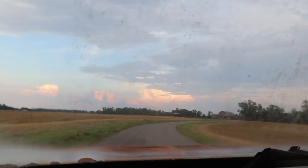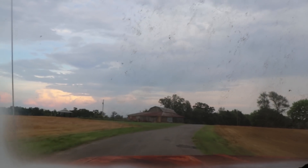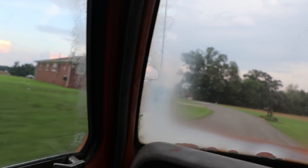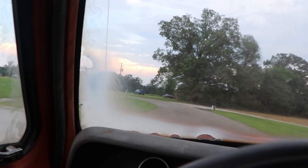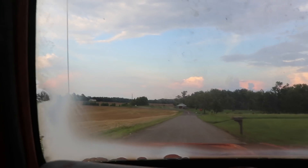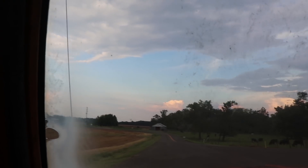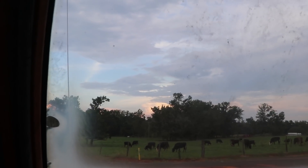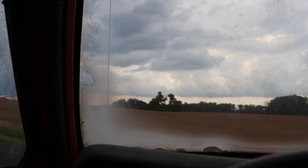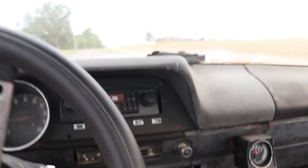Let's talk about all the things that Rump really needs. First off, we could use an alignment, wheels, tires. The brakes are pretty good, it drives alright, but it makes a lot of noise. We need to fix the side view mirror — the window fell down, or actually I think it shattered. We need to fix some wiring things: the taillights don't work, brake lights don't work, headlights work. Pretty much everything from the cab back needs to be replaced wiring-wise. The original harness is pretty much untouched under the hood and inside the truck, besides a few things. It just needs some work to correct things done to it over the years. The first thing I want to do is assess why the brake lights don't work.